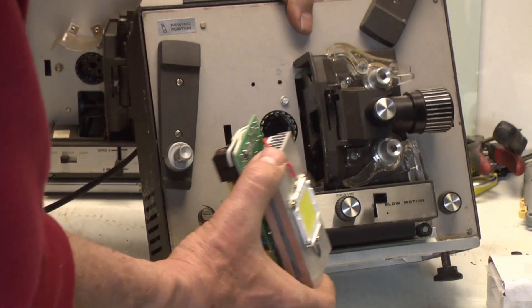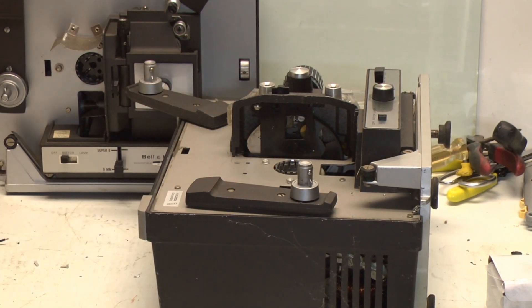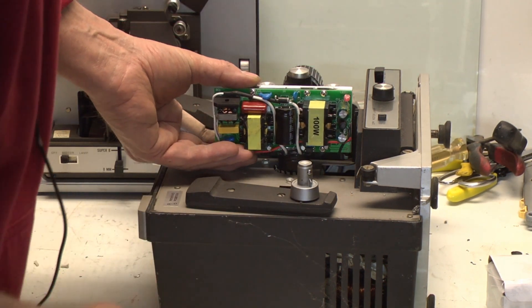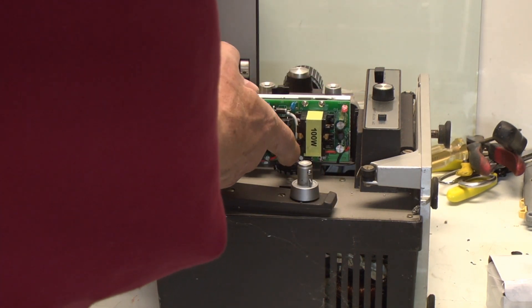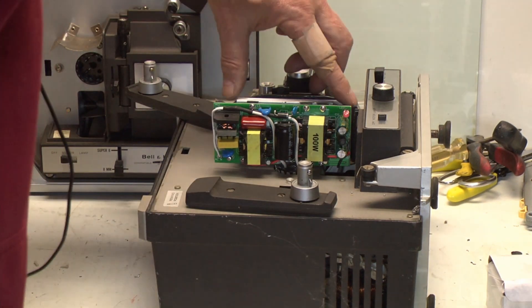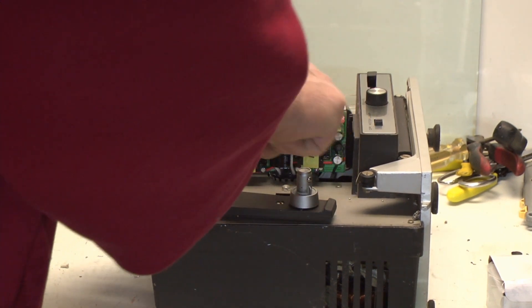The best way to do this is to lay your projector down flat on its back. So lay it down flat, and then take your LED plug-in module and just let it glide down in, keep it square, and push it down in, and it should click into place. If it's tight, if it's firm, it won't wobble around at all when you push a little back and forth on it.